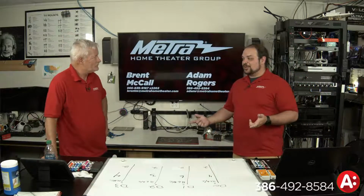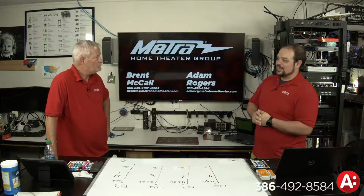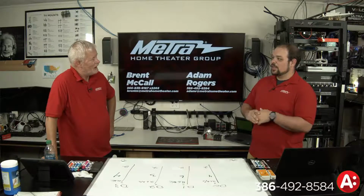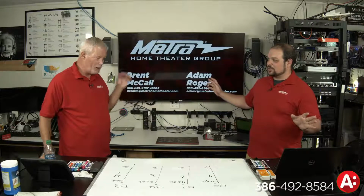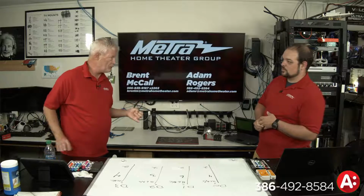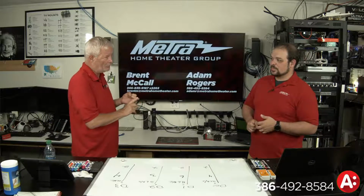Now, here's the thing. What was the first step that we asked him to do? I wasn't here. Well, no, you were here. We went ahead and had him reboot. Yeah, reboot. We had him unplug all the copper connections. All the copper connections. Yep. And gave him a specific reboot order, which is HDMI cables first. Yep. Then the coax cable, because the coax carries voltage.